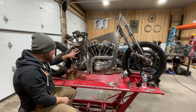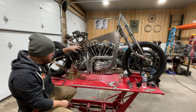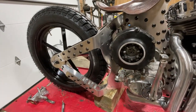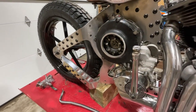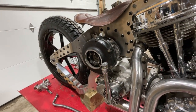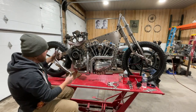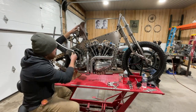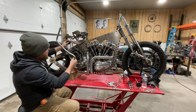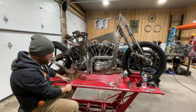The really crazy thing about the bike is the inertia starter. This is actually a World War II V12 Merlin engine inertia starter that they used on the fighter planes. When you wind this up there'll be a plug in here — this isn't the actual one we're using, just an example — but the seat will flip up and you'll plug this into the crank up top. You wind the starter up to RPM and it's essentially a giant gear reduction system.